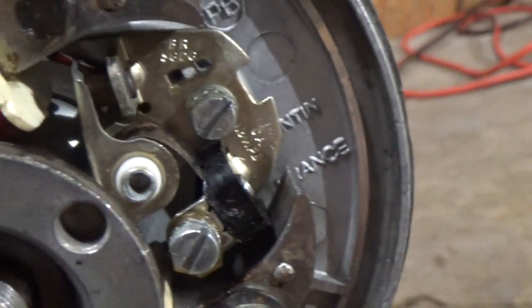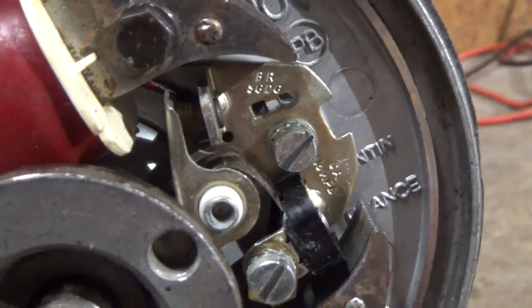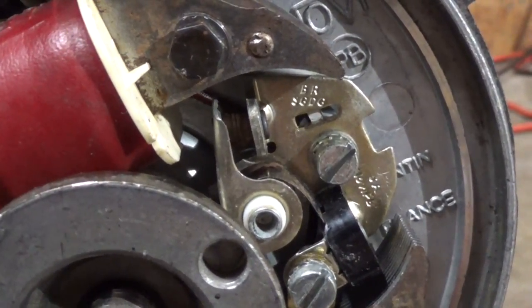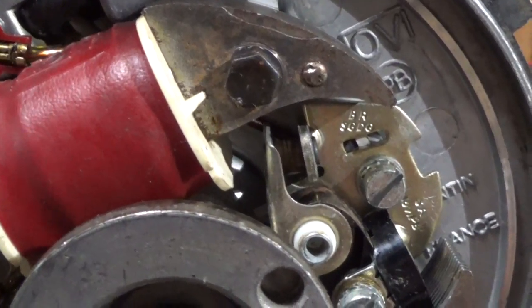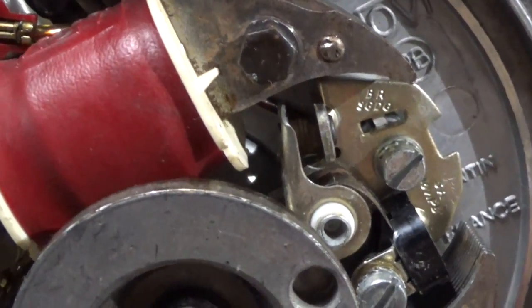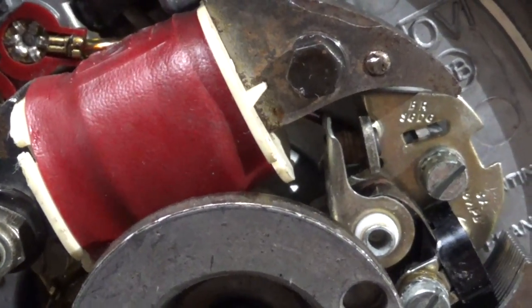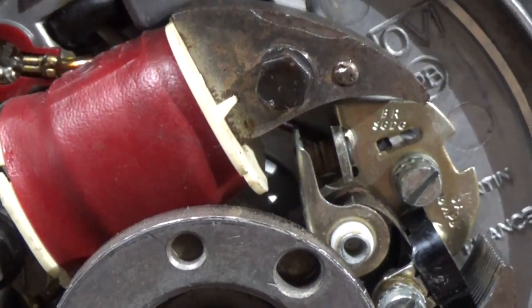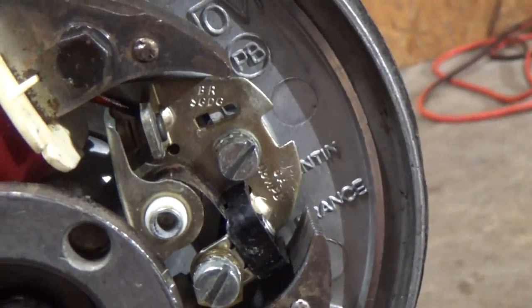And they look like they're making pretty good connection, but they're corroded on the inside. So I'm going to clean them out with some 320 grit sandpaper and some carb cleaner. Then I'll blow everything out, make sure there's no grit left in there, and set the tolerance at 0.35 right there. I'll do that with that little screw right there, and